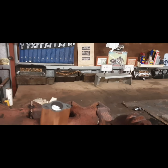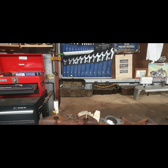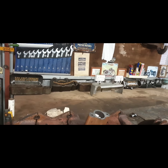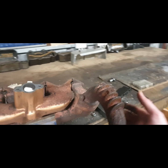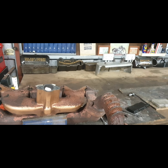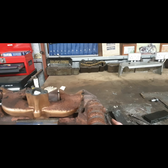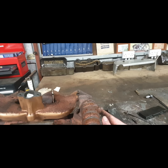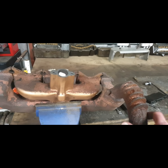At the same time I don't want to be left with a tractor without a manifold on it that can be moved and started. I want to invest the time into getting this A1, getting it right. These studs here — I do remember having a go trying to remove them and it wasn't looking like anything was going to move. Worst case scenario I could always literally drill through them and put a nut and bolt, but I'd prefer to try and keep it original.